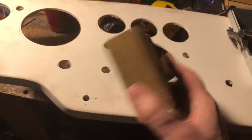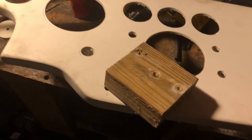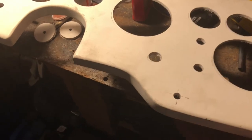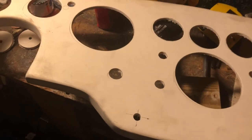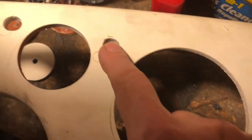One thing — don't forget, and I did make use of this — make sure that you have a block on the back side, not necessarily for the hole saws, which do a nice job, but for drilling these smaller ones, whether using a spade bit or a regular bore bit. With fiberglass you'll get chip-out without a backing block. It's good for wood too — use another piece of wood so you don't get chip-out. I forgot on the very first hole and that's probably the worst one right there.